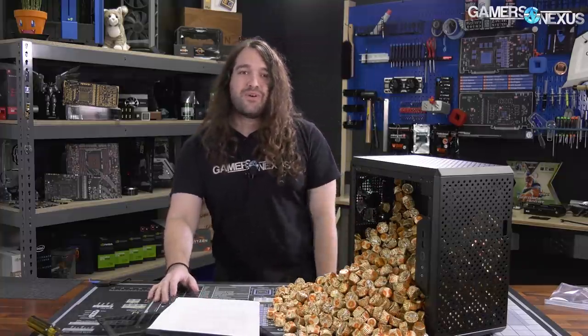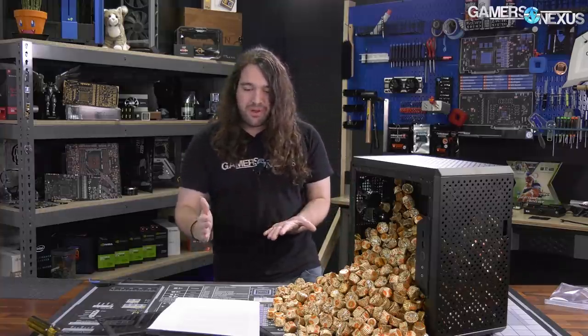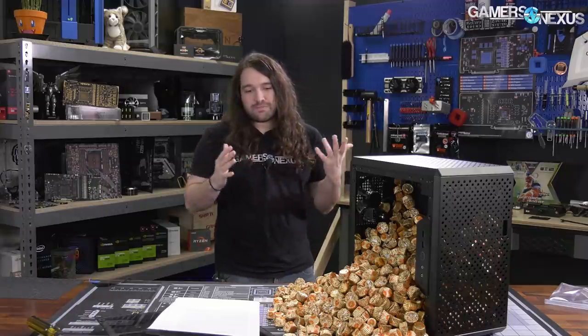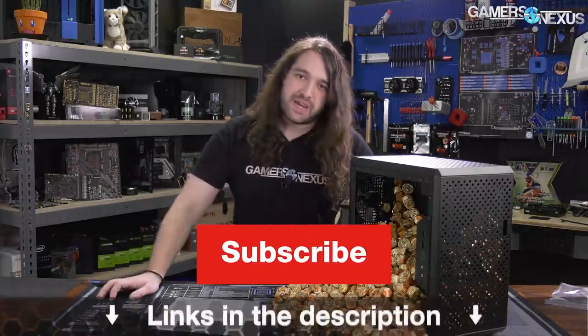That's it for this one. Thank you for watching. Sorry if the results were disappointing for the core-to-core deltas, but we've learned a few important things — there's a lot more to consider than the IHS. Just to really reinforce this, the whole process is more about improving contact for liquid nitrogen cooling, not really for ambient. That's why Kingpin does it — if he uses the CPU as-is with that slight curve in the IHS, the thermal paste can crack and shut down liquid nitrogen overclocking temporarily. Should you also lap your IHS? It depends on whether you want 2 to 3 degrees improvement for air or liquid cooling. If you really do care about further investigation, let us know. Subscribe for more, and you can go to patreon.com/GamersNexus or store.gamersNexus.net to pick up a shirt.